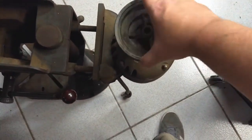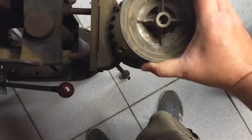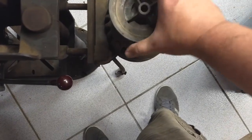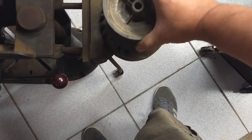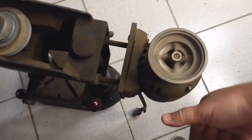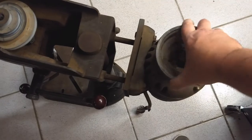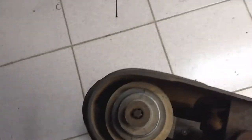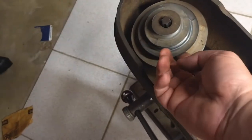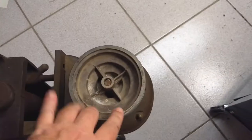It lines up with that keyed edge on the shaft. It's like I'm doing a distributor — I got it 180 out. Drops right on — it actually locks it in place at that point, not as tight as it should be. This one is set in nice and tight. One, two, three, four ratios up front, times four possible ratios on the back — so yeah, 16 speeds.